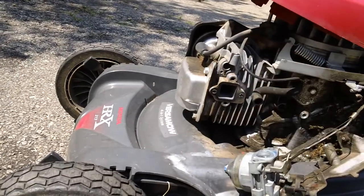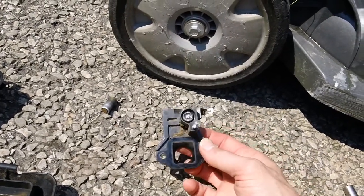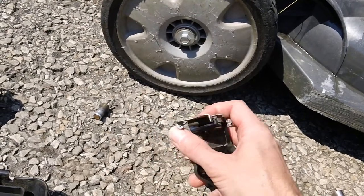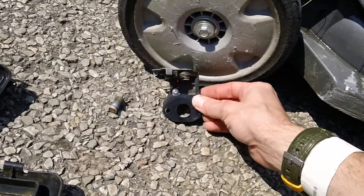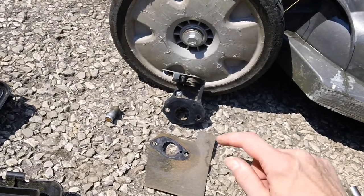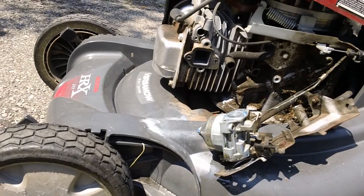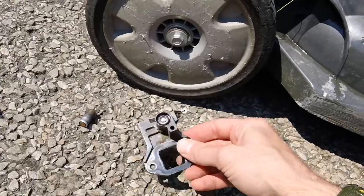Behind this piece, I'll show you what's on the back side. The back side has a small plunger mechanism. That back side faces the outside portion of the cylinder block area. The front side is where the carb mates up. You have your gasket right here — the gasket mates up against the front side, and then the carb fits on that, so everything lines up in proper alignment.